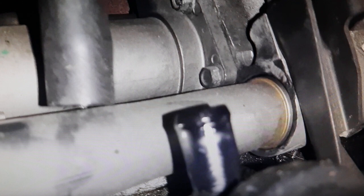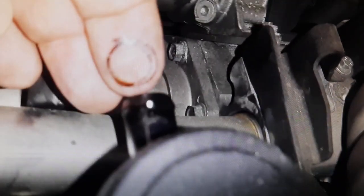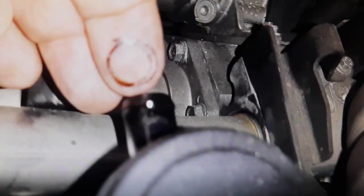In addition to that pressure coming out in the form of oil vapor, the liquid engine oil would also come out. You can see that my finger has a circle of oil. This is because when the oil cools, it liquefies — it becomes liquid, and that is why you see those spots. But in the center of that circle, there are no traces of oil, which means that no oil is dripping.